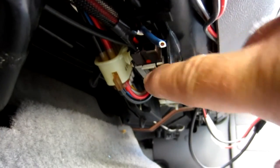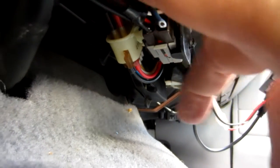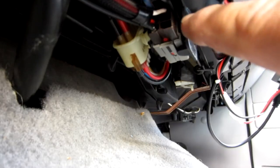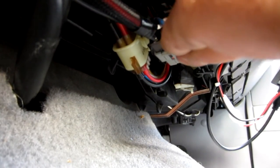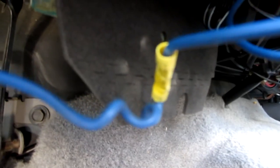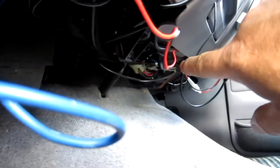It looks kind of like spaghetti under here right now, but I had this connector already and I believe almost all Ford trucks have it. I bought the harness from Tekonsha on Amazon — I'll put the link below. Before I plugged it in, I checked all the connectors on the factory Ford harness to see if they were all being energized. Every one of them was exactly what it was supposed to be, except for the one that turns on the brake — basically the one that energizes the whole system. When you push the brake and the brake light comes on, it's supposed to energize that lead, and it didn't. So I plugged in the harness, ran it over here, and hooked it into my brake light, so now the brake light energizes that wire just like it's supposed to, and the harness does the rest.